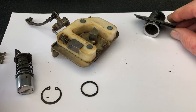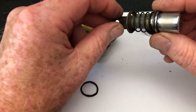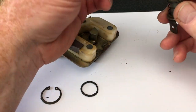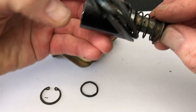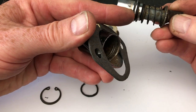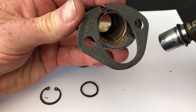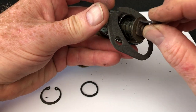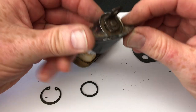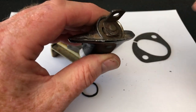Talking through the actual mechanism itself, this is where it gets a bit complicated. Here's your barrel - I've got to get it back into this piece in a minute. To avoid the mistake I nearly made, just push it back in carefully through here. There's a slot in the bottom where you can see there's a couple of tangs, so you need to make sure they align with the slot in there. Then it will nicely drop in and those do move, so just be careful of that.